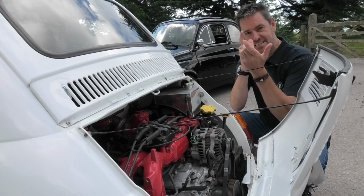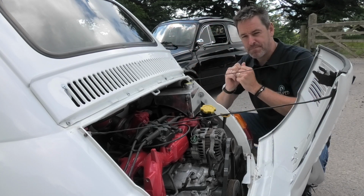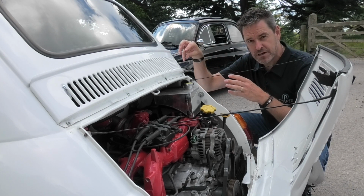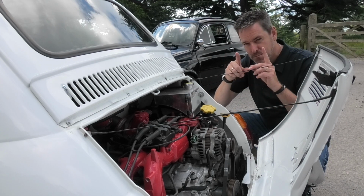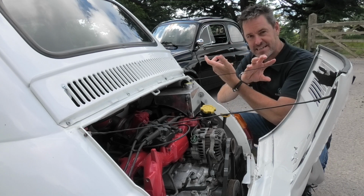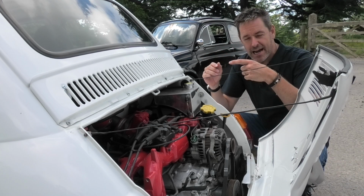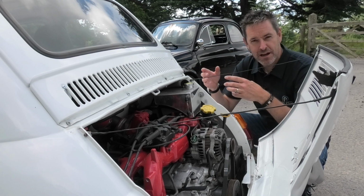So it's been rotated through 180 degrees. So you've got the engine and then the gearbox. This car isn't 4-wheel drive, so they've basically taken the transfer box off the front and just blanked it off. So it is just a rear-wheel drive car. But think about it, I've taken an engine and rotated it through 180 degrees, and that basically now means that it's spinning in the wrong direction. So this car would have 1 forward gear and 5 reverse gears.